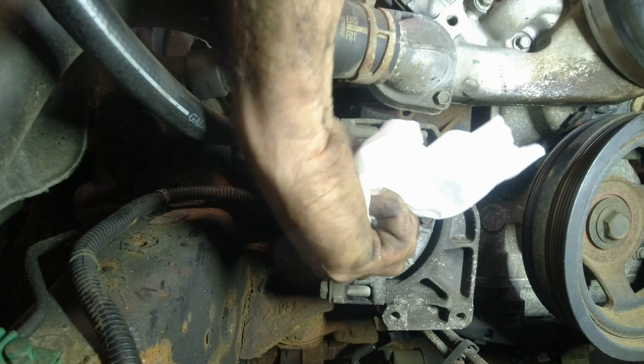In there. Down here. I'm looking at about 4 thousandths. This one's sitting about 4 thousandths lower than this one. That's not bad. Your human hair, believe it or not, is about 3 thousandths. So it could be the variation between me not sitting quite right. I think we should be good. We'll test it once we get down there, though. So make sure you got your shim in there. Put this on.